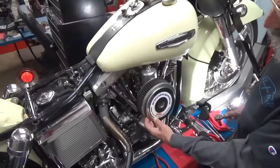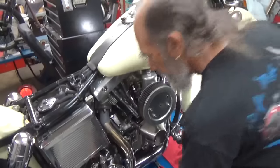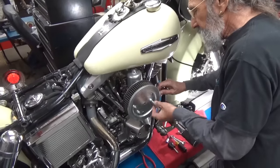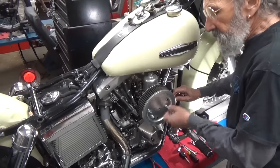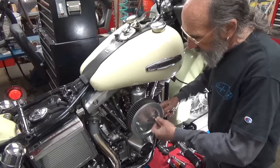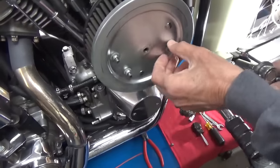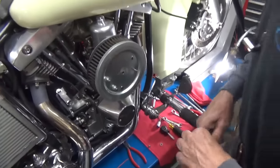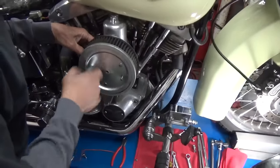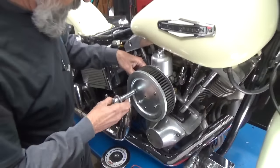What's on it now is a plate off of a Volvo boat engine — I've got a pair of them. The rest of that air cleaner, they were spark arresters. Somebody gave them to me at my old shop a long time ago. So I kind of made up my own air cleaner out of all this stuff and I've been real happy with it. I was really proud of myself for the backing plate I made — I went to the metal shop and bought a piece of aluminum, took a hacksaw, made several cuts, then fired up my belt sander and held it spinning to make it perfectly round.